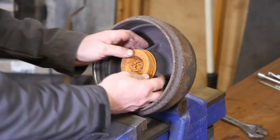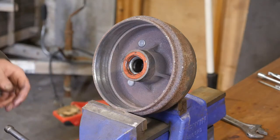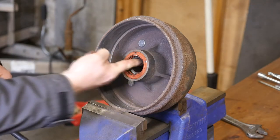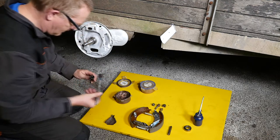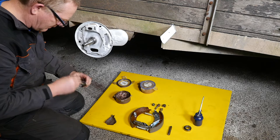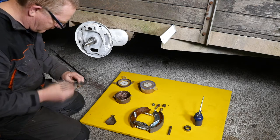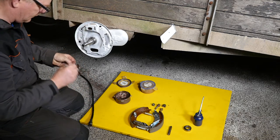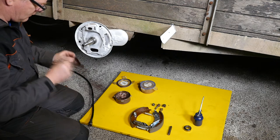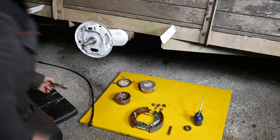There I am in my protective gear. Now I can remove the latex glove — job's done and it still rotates. I'm now going to put the cable on this side, putting a bit of copper slip in the cavity of that brake cable and a little bit on the half shell, just to try and prevent further corrosion.